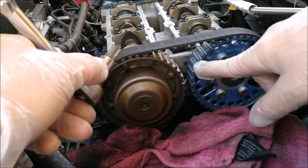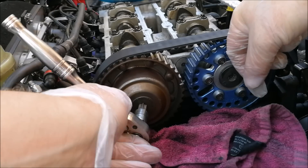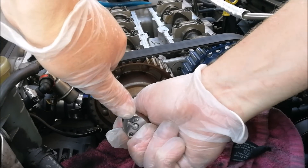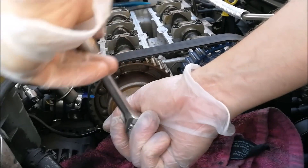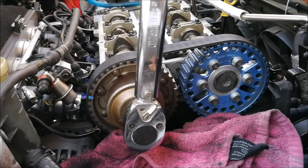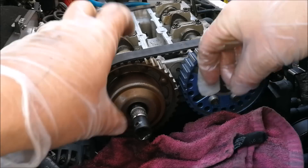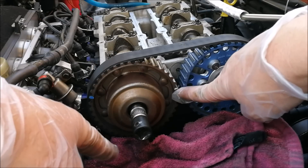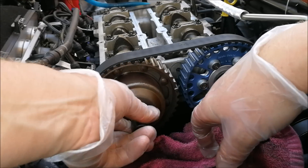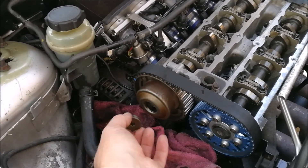Okay, so the belt's tightened up. I'm just now going to remove the cap here - I've got a rag to catch any oil from the VVT pulley. This is just the oil cover cap, not the actual bolt for the pulley. By slacking that off now we've allowed the inner VVT mechanism to self-right itself. We don't need to worry about the outer lines - all we worry about is that the inner VVT has flipped itself to its neutral position. Now just tighten it back up to torque - 68 Newton metres - then put your cap back on and the job is done.